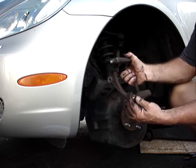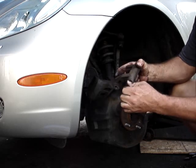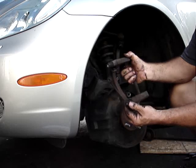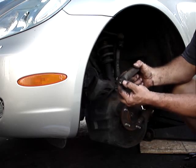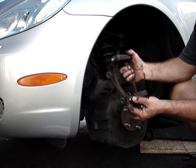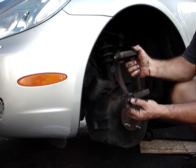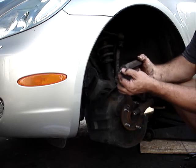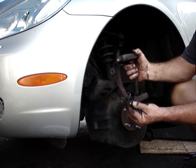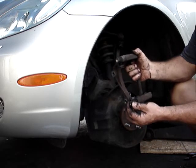Make sure these slide pins are free — twist them a little. They'll usually be a little sticky, but they should move in and out nice and free, not binding. If these are frozen, the brakes aren't going to work. This is what your caliper rides on — as you push it, the caliper moves in and out with these bolts. That's what it's actually screwed onto, so if these are seized up solid, it's never going to work right. Make sure they're free.